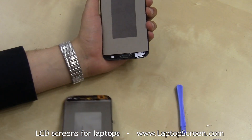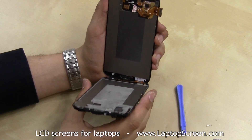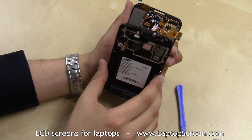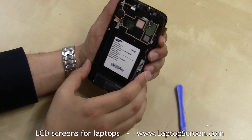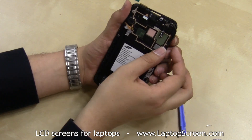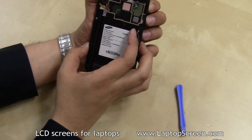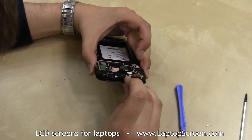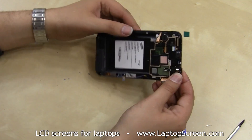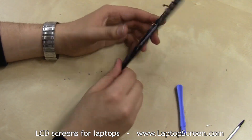To fit the screen onto the front assembly, start at the bottom, making sure that the white light filter wraps around the button and the flex cable. Start closing the display with the front assembly — the digitizer and display connectors have to be threaded through the frame at the top. The speaker grille can be inserted just before closing the display fully. Firmly press around the perimeter of the display to catch the adhesive.